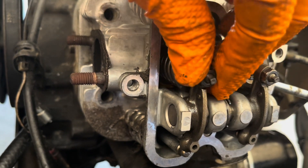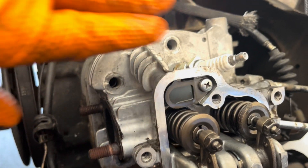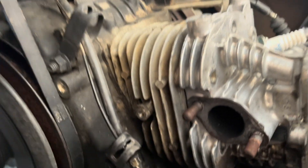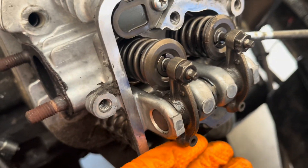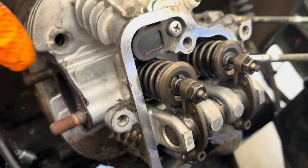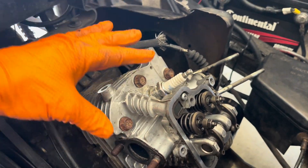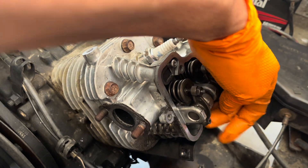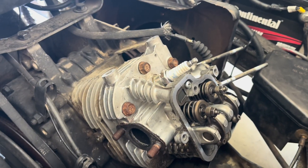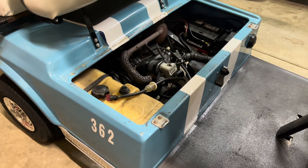There's some issue at the bottom. When I go to torque this thing down, I'll be careful to bring this up and into the seat and tighten it down — it tightens to 18 foot-pounds. Just as I figured: as soon as I snugged these up, not fully torqued yet, the lifter fell right into place — snug as a bug in a rug. That is perfect. Let me get the torque wrench and torque those down.